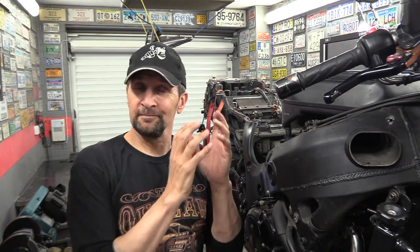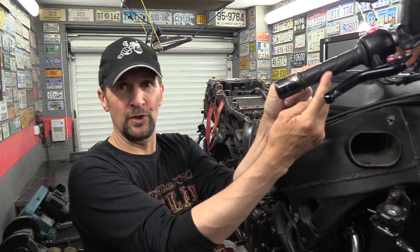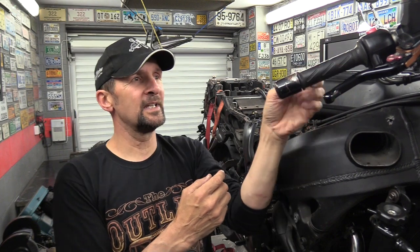It'll snap back nicely at the end, and if you can complement that with a new throttle tube, because that gets all slimy and horrible inside, or even at least clean yours, this gets lubricated inside this tube, and obviously that turns into a waxy putty as well and causes more resistance, which means when you get this, look at that, that's stopping at half throttle.